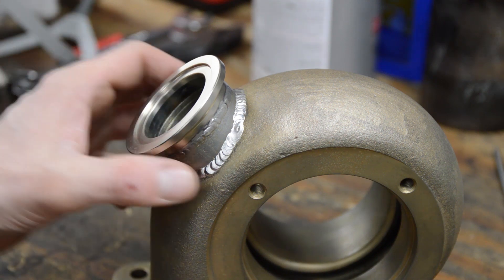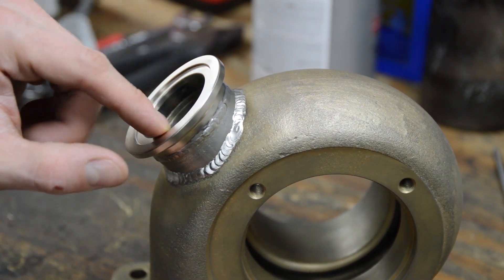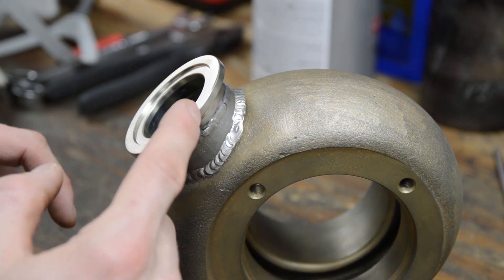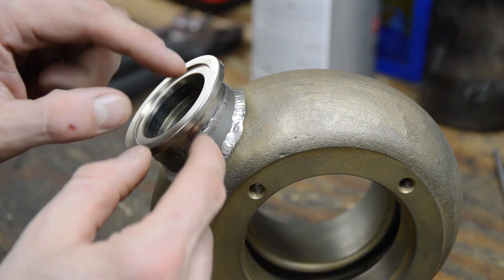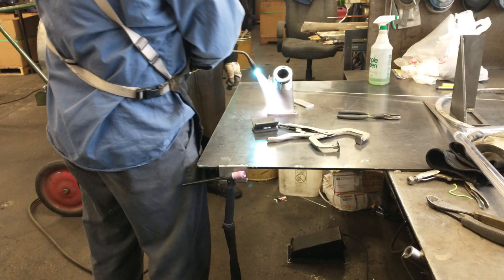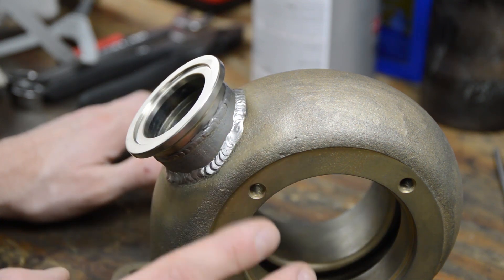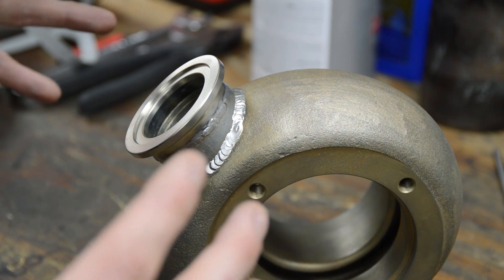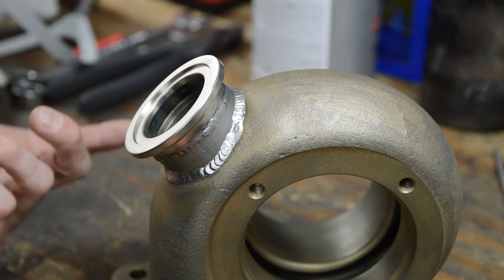You're going to get a much more accurate hole size. This stub here is just steel as well. The stub was welded — I believe stainless steel filler, so probably 308 or 309. To weld this assembly to the casting, we preheated the casting to 300 or 400 degrees and then used a 99% nickel rod as filler. After welding was done, we threw it in a bucket of sand and buried it. The reason for that is to slow the cooling process as much as possible, which relieves any stresses and potential for cracking.